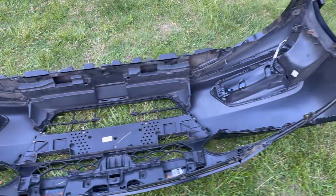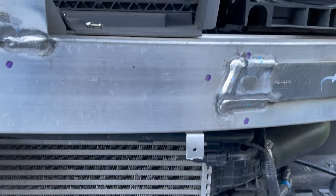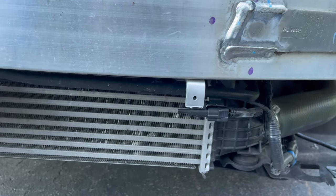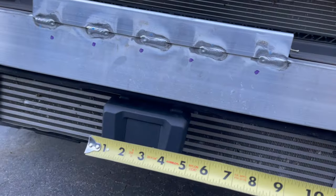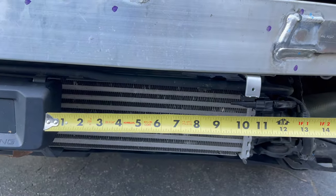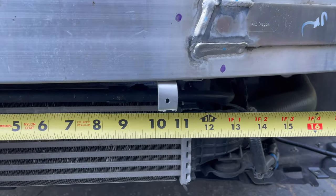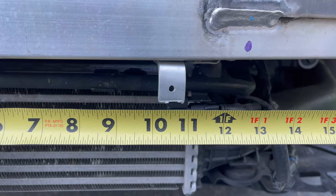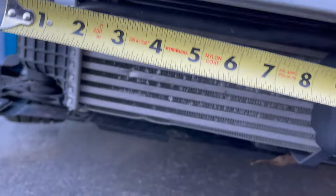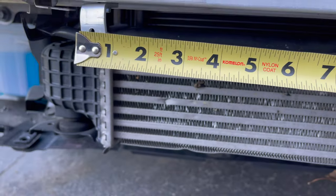That bumper is ready — it is not going anywhere! Here's the measurement: I don't know if you guys have these welds in the same area, but it'll be close. I want to show you from where the Honda Sensing module is so you can figure out where to put yours. From Honda Sensing all the way here — right at 10 inches it finishes. Only I do this, guys, only Redline Mods. Same thing on this side — right at 10.